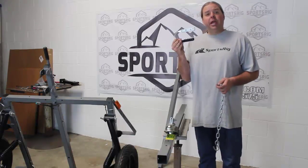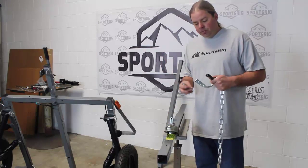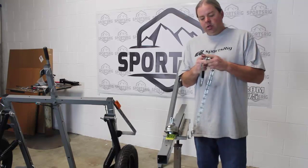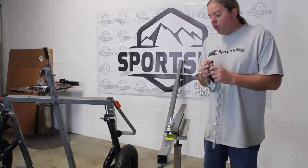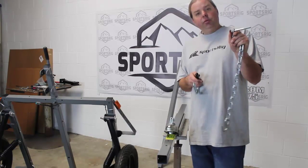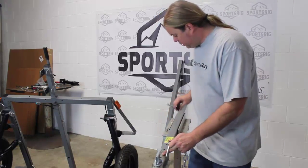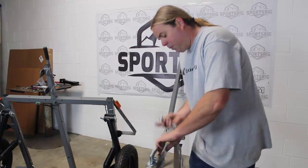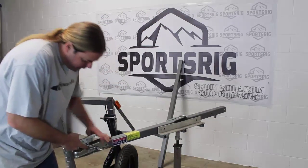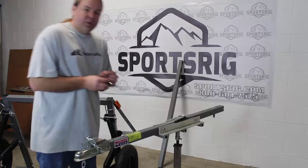We're going to be installing this with the handcart handle — it's one of our popular accessories, so hopefully you did get it. In the hardware bag with the handcart handle comes a longer bolt that allows it to compensate for the thickness of the handle. If you didn't buy the jack stand handle, the normal coupler hardware comes with the proper bolt — same setup. So we're going to put the washer and the longest bolt through the chain, slide that coupler over, put this down. I put the chain on the right side — hopefully we'll line those up, put that through, and now you can just handle the chain over. It's got a little extra weight, helps keep everything from flopping around on you. We're going to put the back bolt in.